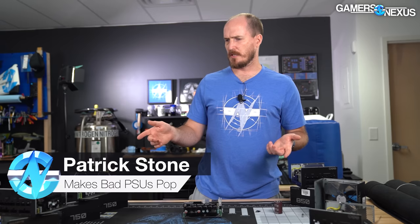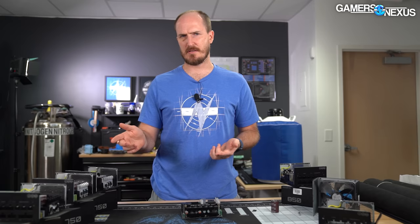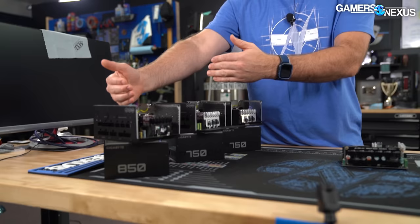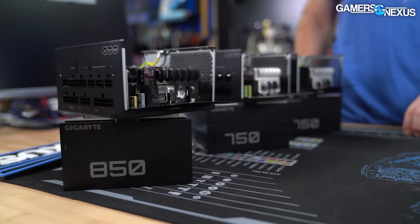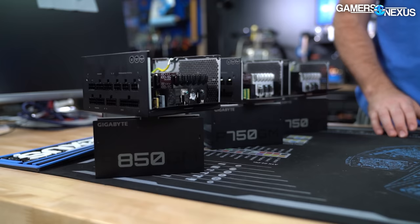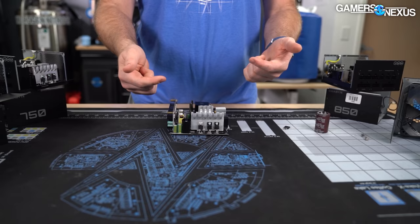We attempted to do a root cause analysis by opening them up and looking at individual components. What we found was that some of the parts inside the PSUs weren't all from the same vendors, and this differed based on the model — in some cases maybe just random chance. When we looked inside, we did find different parts. This makes some sense — if you've got an 850-watt unit and a 750-watt unit, they have different outputs, so you're going to have different parts. But even still, maybe they should be from the same vendor. What's strange is when you've got two 850-watt units from the exact same family — supposed to be the same — and there are different parts.